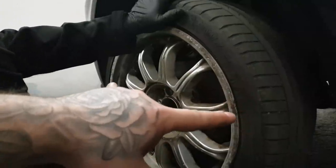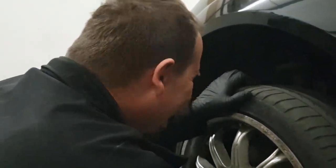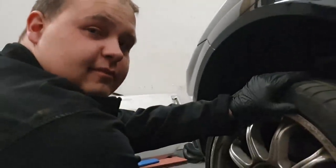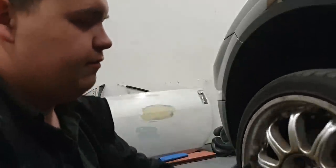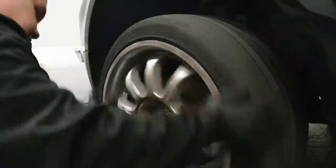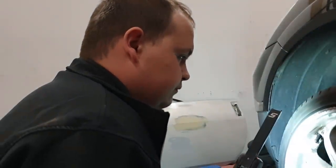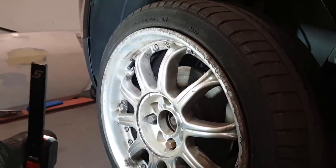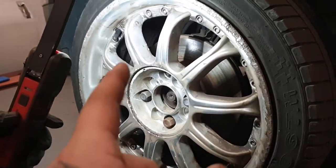Give the wheel a spin to check if your wheel bearings are rough — you'll hear or feel it if they're bad; it will be noticeably loud or high-pitched. Check the discs and make sure the brake pads have enough material on them and aren't grinding on metal. You can see the pad thickness right through the wheel — you want plenty of pad left.